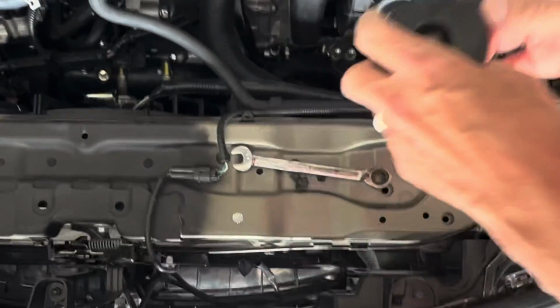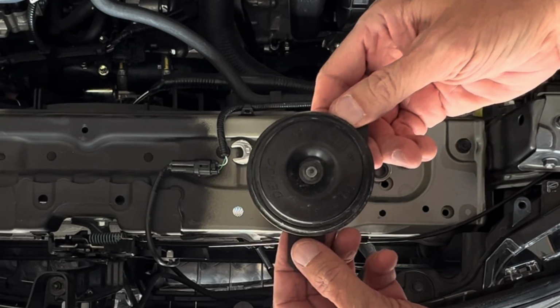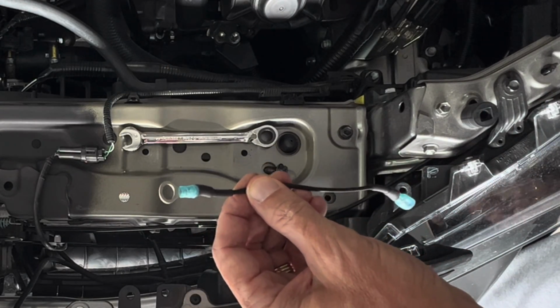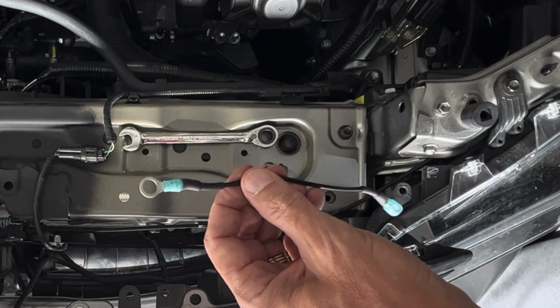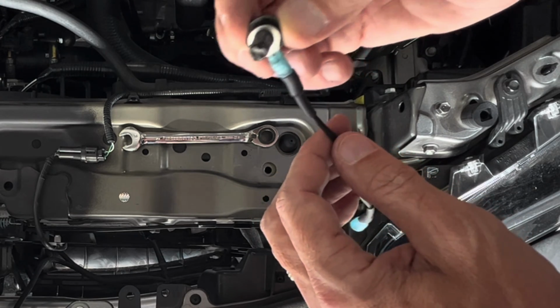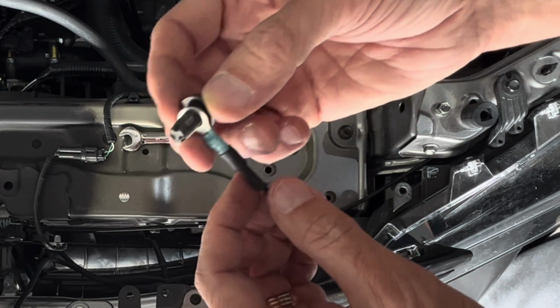There we go. And then out comes our teeny little horn. So I did make a misleading statement before. I said that both of the rings need to be M6s. This needs to be an M8, so this 12 millimeter bolt can fit through it. So I will make that correction at the beginning of the video, but you also know about it now.